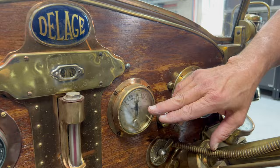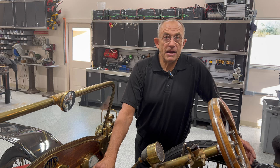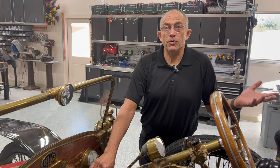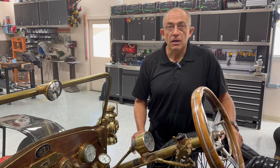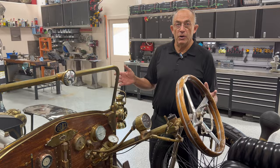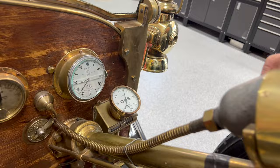This is your tilt meter — for hill climbing it shows you the angle of your tilt. In hill climbs that would be really important: for a zero to five percent grade you could climb in fourth gear; a seven percent grade, no more than third; a 12% grade, no higher than second; a 20% grade, you've got to be in first. Instead of not knowing and messing around trying to shift — and these weren't easy cars to shift — you would know exactly what gear to stay in.